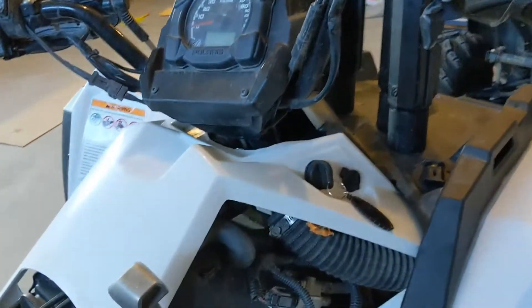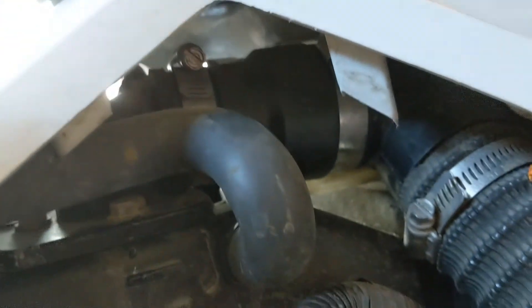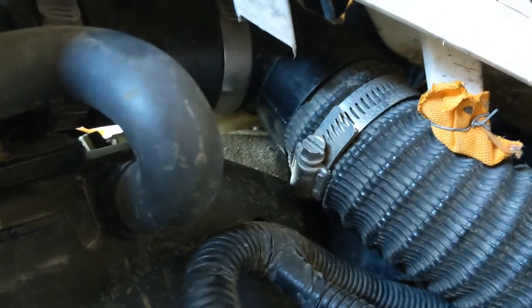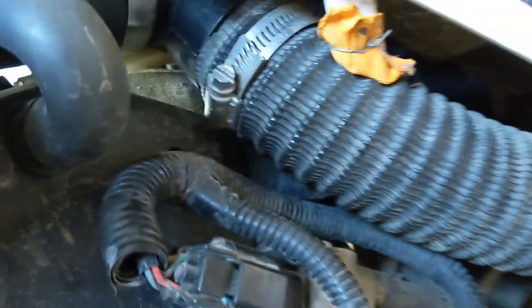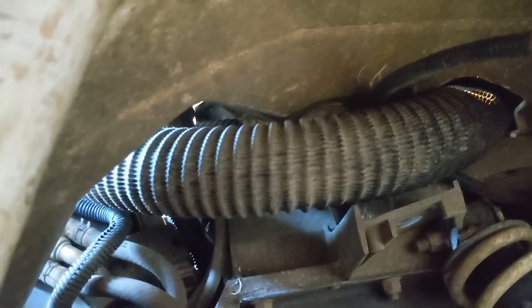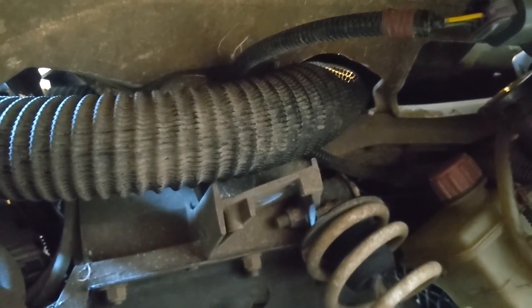A lot of wasted man hours adjusting things. We'll start with the right side here, the air box. For the air box, you have the warrior plate here that goes on top, which you silicone down and screw down. And then these are just two plumbing rubber couplings that go from a one and a quarter to one and a half inch pipe. And then a 90 — which I had to change from the warrior kit to fit better — and then into the pipe, which comes around and then out in the wheel well. It'll come out and around and then, as I'll show you in a bit, you have to cut the plastic on the hood to get it up underneath or on top of the battery compartment.